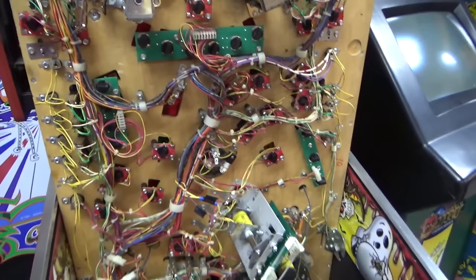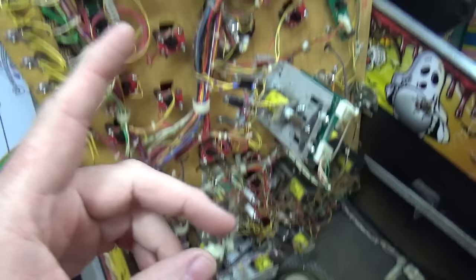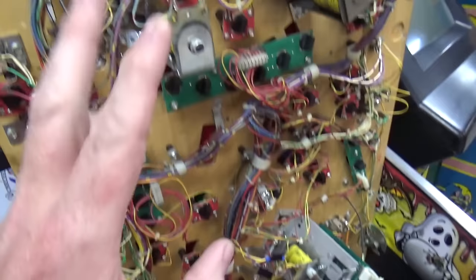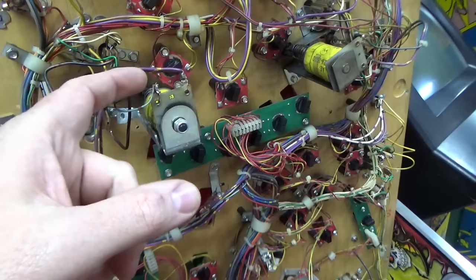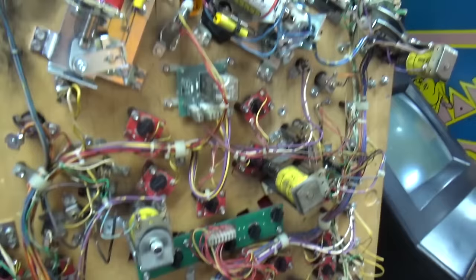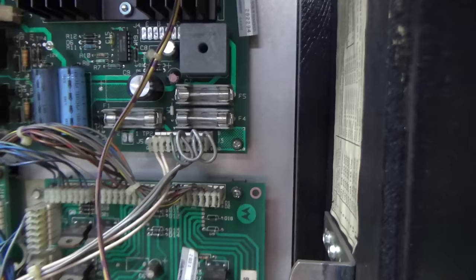I don't see anything obvious that would make a fuse blow, but here's what we're going to do. I'm going to take a multimeter and measure the ohms. If you've got a fuse blowing, this is one way you can figure it out. If a coil shorts internally it will blow a fuse. So I'm going to use the two leads and measure resistance across the coil — this coil is just a big long wire that connects here and here, and that resistance should be over about two ohms. If you get one under two ohms it's probably going to blow a fuse. So let me check all of those coils real quick.